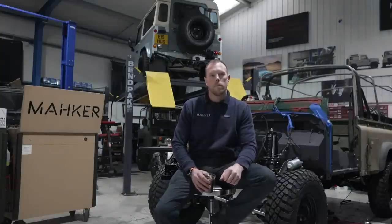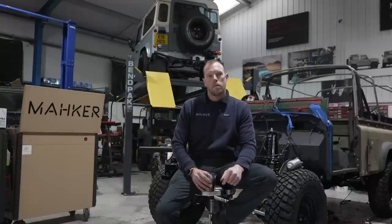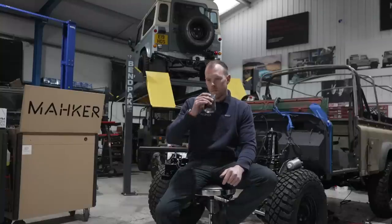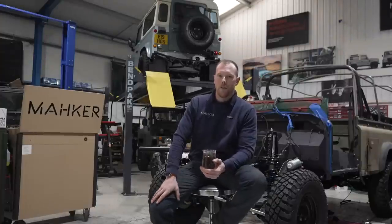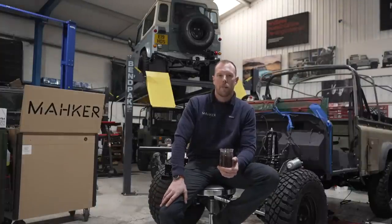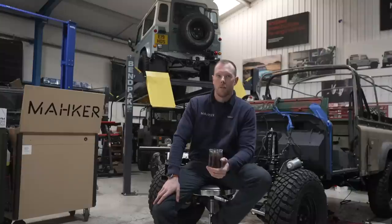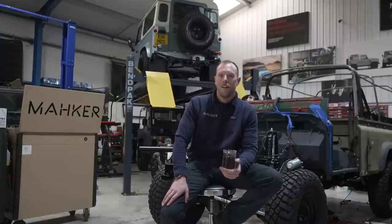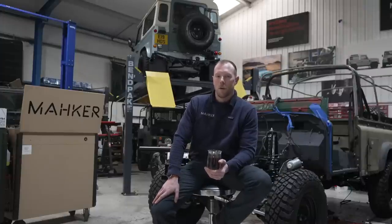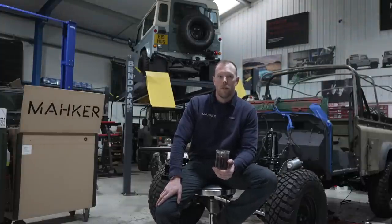Cool. Robert Orr, also on YouTube. Does the LS3 fit into a 64 Series 2? So it will fit into a Series 2. It has to go right back. I mean, right back up to the bulkhead. So the bulkhead will need some mods to clear the manifolds. We were planning to do one this year for a guy called Dan, and unfortunately it got pulled out because I think his missus got wind of how much the bill was going to be, but we will be doing one soon. If not, hit us up and we'll do one for you.